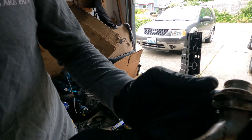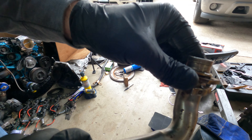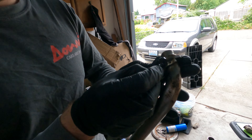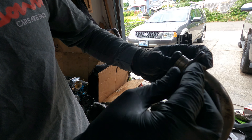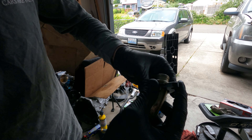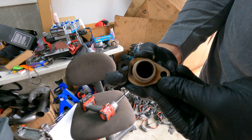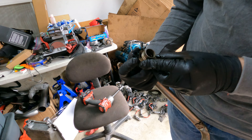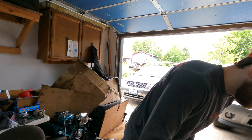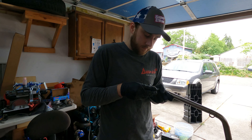So we got that little top part — I just had to grind that off so this would fit over it. For this third gen engine, just like that — that gives you a second bolt hole. That fits great now that we've ground it down. With this particular pickup tube on this year of gen three, I guess you just have to cut that and there it goes.